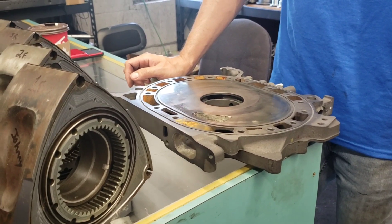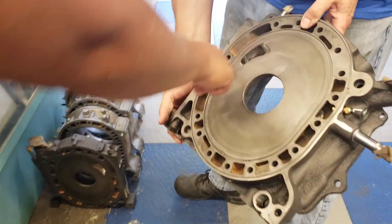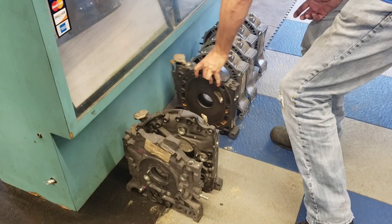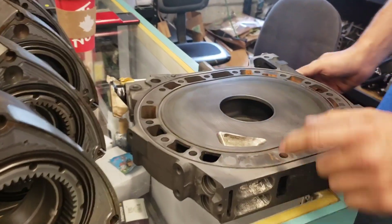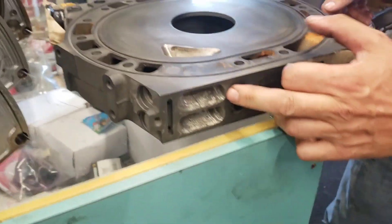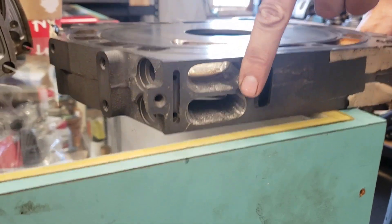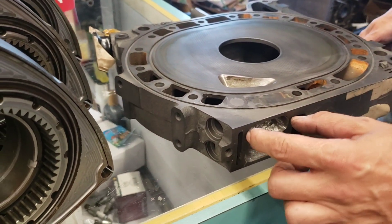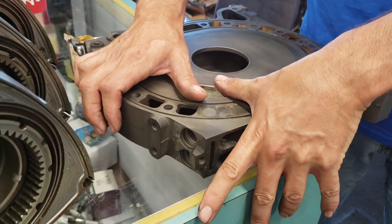So this is one of many. You do the same thing here — a little bit of porting. Yeah, fully ported. These are all street ports. The most challenging part was this one — this is a primary port. And that's where this has been increased in size quite a bit. Stock it'd be right up here probably, so the runner has been extended down to Cosmo 20B spec. This port starts out probably about that small.